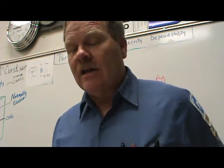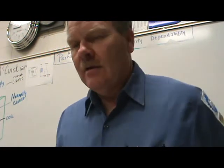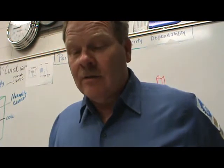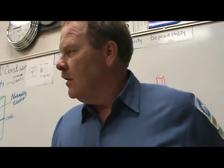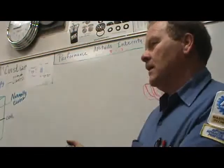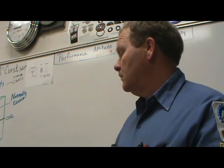It's easier just to take your impact, if the bolts will break loose that easy, and go zing, zing, zing. Yeah, well, sometimes I don't. That one yesterday didn't work, did it? We had to really bust our fanny on that one bolt. And how did we do that, Wes? Listen to this. You've got a good 14 millimeter socket, and you got a nice heavy duty one. You're down on there good, and it's trying to slip on the head bolt.